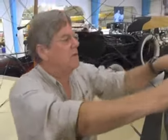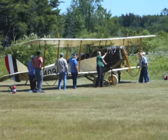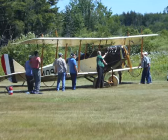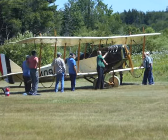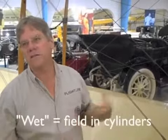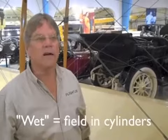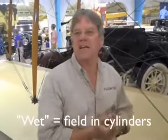Once you're in and strapped in, one of your ground crew is going to pull the prop through. This airplane has a choke on it, which is rare for an airplane. You need somebody to hold the choke on this side and somebody else to pull the propeller to suck the fuel up, and it's generally good to have a pilot in the seat already. It doesn't really have a primer like we're used to, but once you get it sucked up you can tell that you've got a wet airplane and it's probably going to fire.